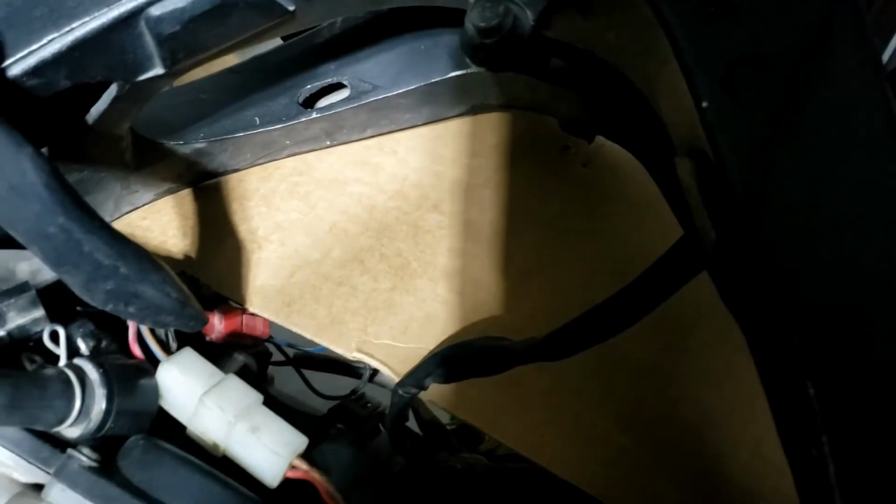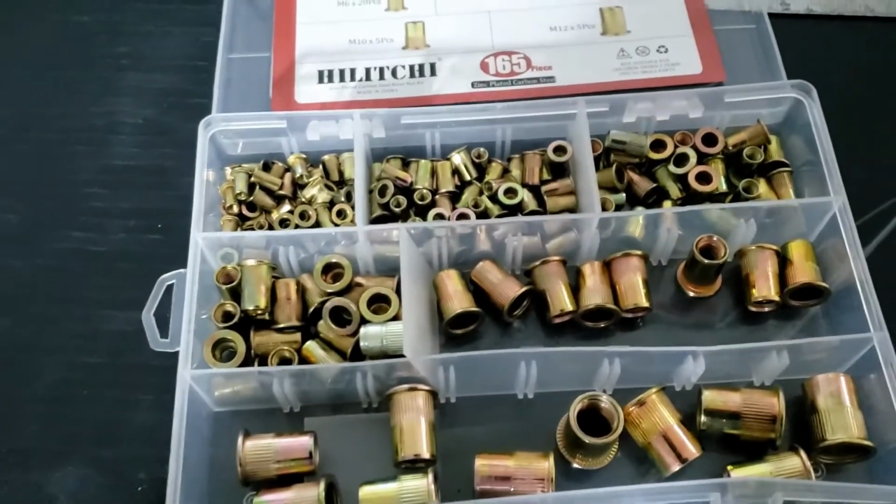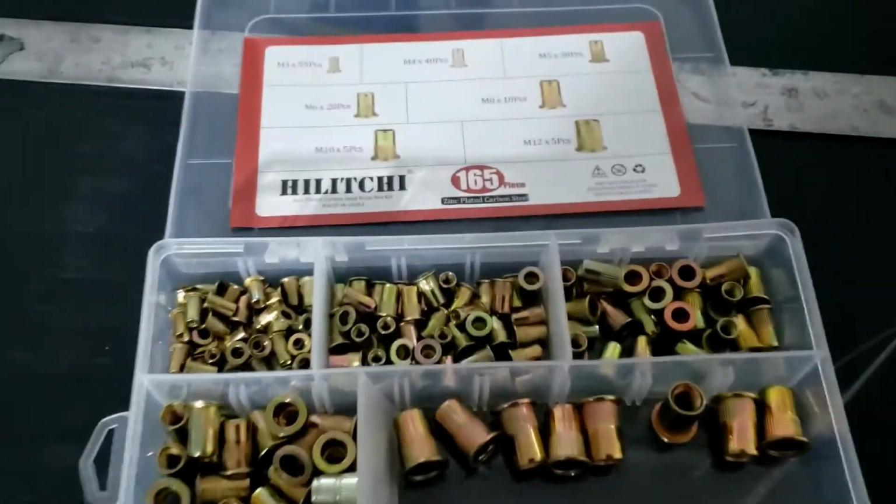Yeah, so we have a tray. Well, we don't. We've got the beginnings of a tray. And yes, how would we mount it? Question. And you might remember there's a bolt hole up here already. So that's the front sorted. And for the back, I think we've got quite a lot of frame here to deal with. So I'm thinking drill a 10mm hole and use one of these boys. Yes, my new favourite devices. I think that will work beautifully. Or I could be very industrious and just drill a smaller hole and tap it. But I like those rivet nuts.